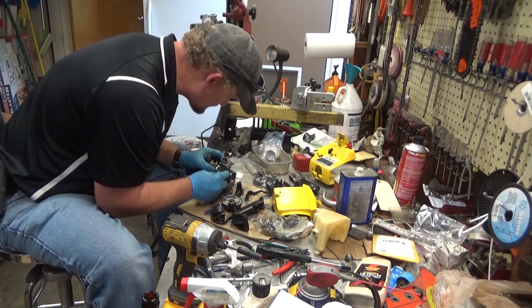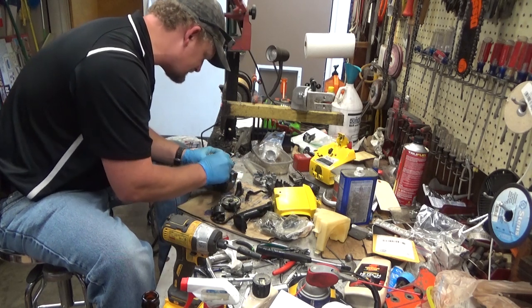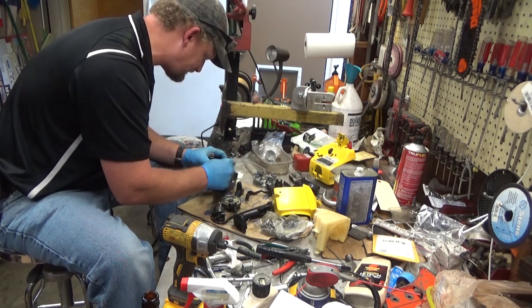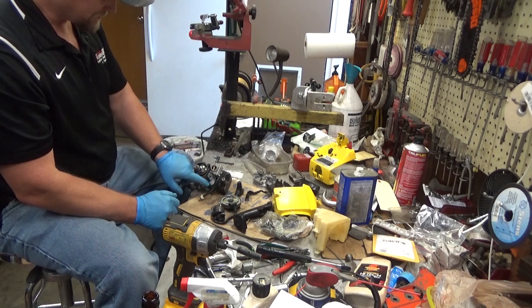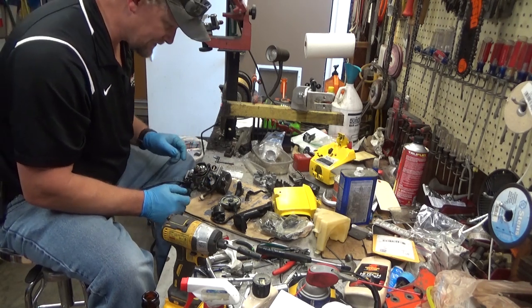Okay. Once the carburetor's there, let's carefully work another one in. Start with the gasket, give it a push. There it goes. You'll feel it drop. If you have to force these things, there's probably something being done wrong. You don't want to blast those ends out and get them out of shape, or they're just a complete pain in the ass from there on out.